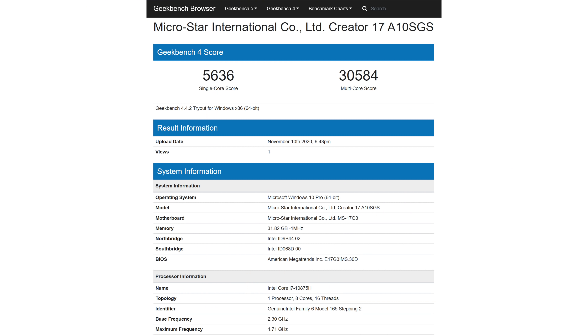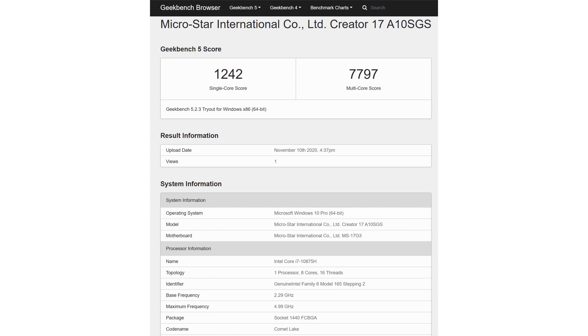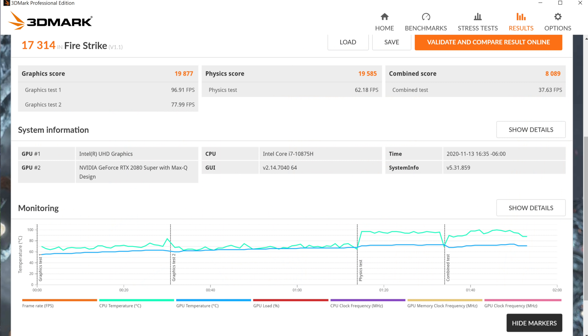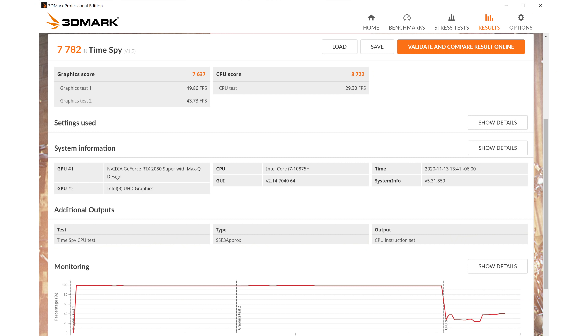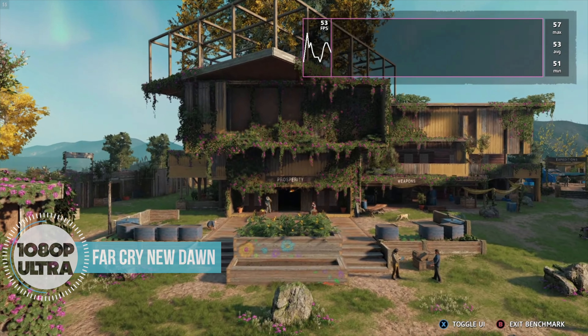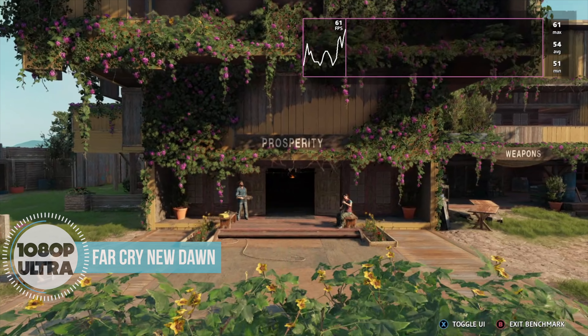The IPS 4K sits somewhere in the upper half of the price range, but not as expensive as ours. For our top of the line model, we have 32 gigs of DDR4 2666 MHz RAM. There are two RAM slots, so 64 gigs would be the max. You get a fast M.2 NVMe SSD, and there are actually two slots here — so that's good performance specs right there.